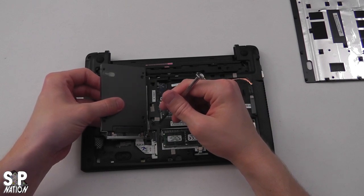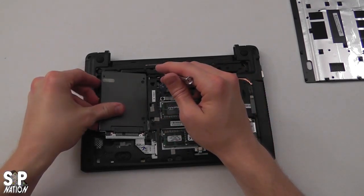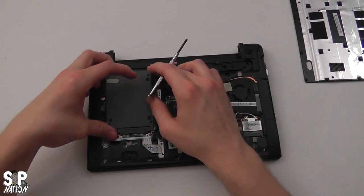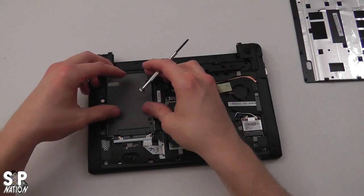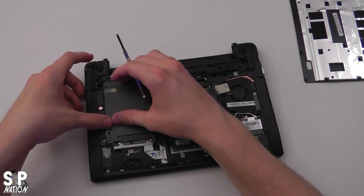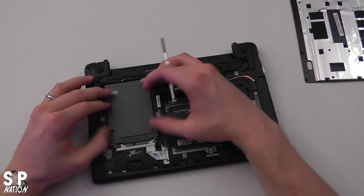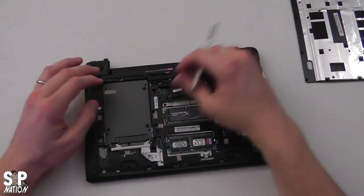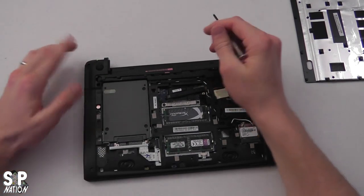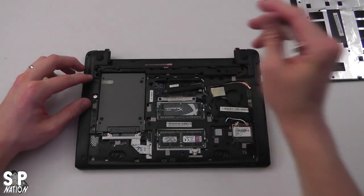You almost need to press them down together. And there you can see my ribbon is tight—you don't want to pull hard on it; it's not coming out. I'm going to gently place my Kingston solid state drive back down into the receiving compartment. This is why you definitely want the 7mm. There is some foam in there so you may have to press just a little bit to get it to lock down. Once it's in, you're all set and ready to replace the cover.